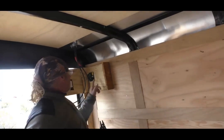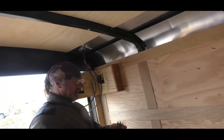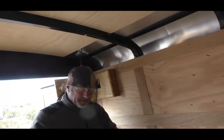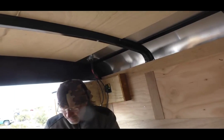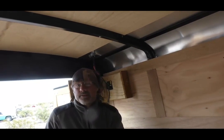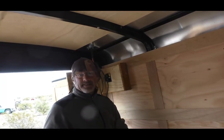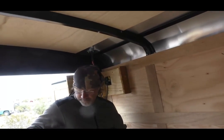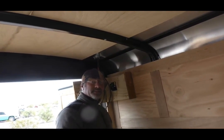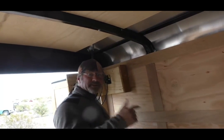The fuse block only has a positive side, so we're going to put positives through the fuses and all the negatives will go to the negative on the battery. When you set a system like this up in a van, you don't want to ground to the frame or chassis — the system is independent of the common ground on the vehicle. The only time you want to ground to the chassis is if you're integrating an isolator to pull energy from the alternator. We're not doing that, so we're not grounding the house battery to the chassis of the trailer.